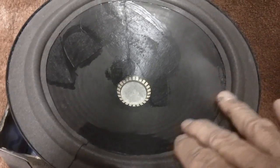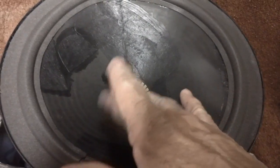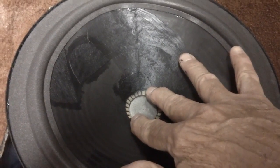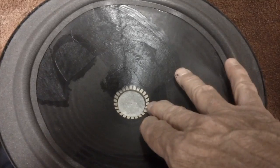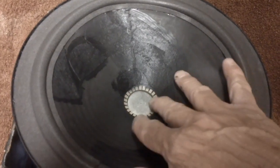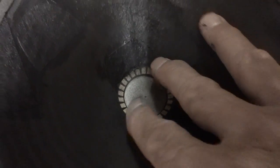Well, the surround is in - it's all nice and glued down. It looks pretty good, not the best job in the world, but I had a warped speaker right over here - the cone is a little warped right there. Unfortunately, I found out that this speaker is a little bit weaker than I gave it credit for. When I was taking just two fingers and pressing the cone up and down to see how much drag I was getting on the voice coil, I could feel my fingers begin to sink through the cone. I went ahead and patched them - they're nice and solid now - but we still have a little bit of drag. Can you hear it? We're going to have to live with it.